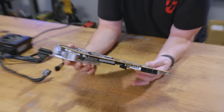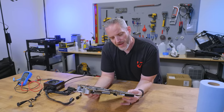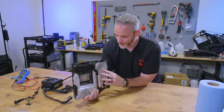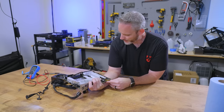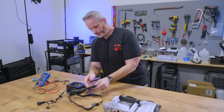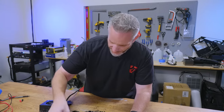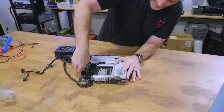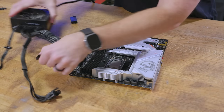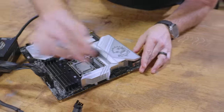The reason why I was expecting to see a burn mark — and I should be doing this with a magnifying glass or microscope — is that I heard a pop when it turned off. So I was fully expecting to see something on here blown up. First and foremost, I've got to plug this all together. Before I even put RAM in, I'm going to plug it all in and see if I'm getting 12 volts to the areas that I'm supposed to be.